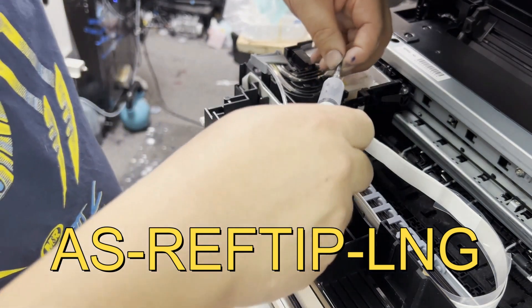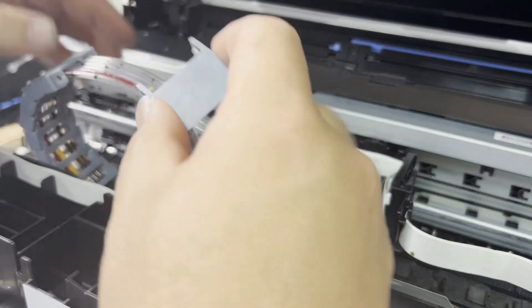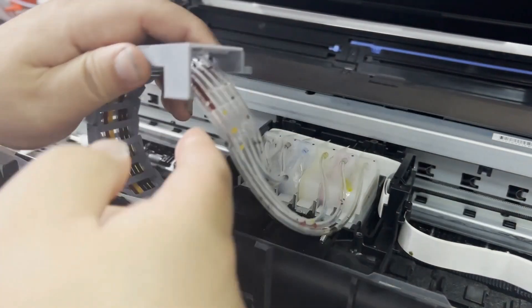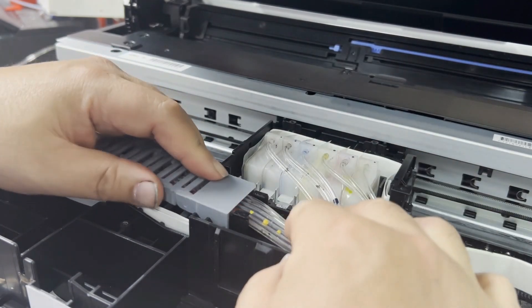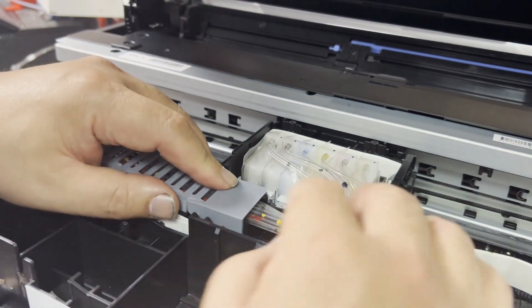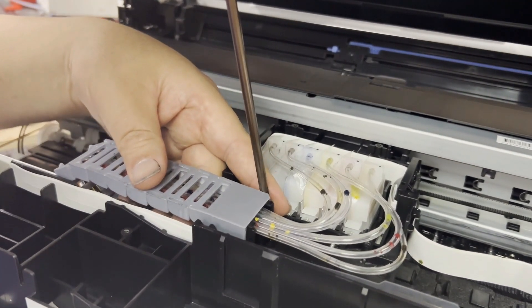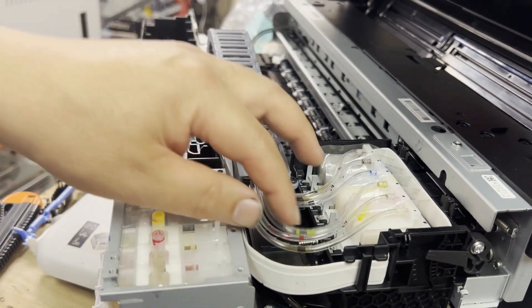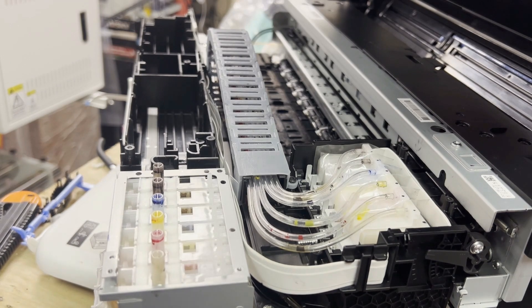For the product I mentioned, I'm going to put a link — the print head and the drag chain can be taken out separately, although it comes preassembled. But later you might need to uninstall this, so I made it detachable. This long hook is going to catch the bottom of the carriage. Then on the other side you're going to see a screw hole — secure that screw and the whole thing is installed. You don't need the lock to be installed back. If you have a DTF printer, you probably just want to leave it like this because you have room here to install a secondary tank.